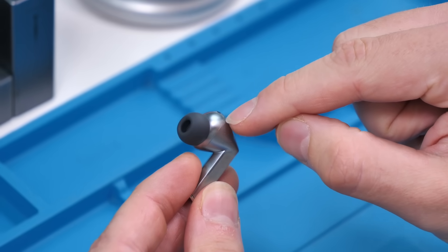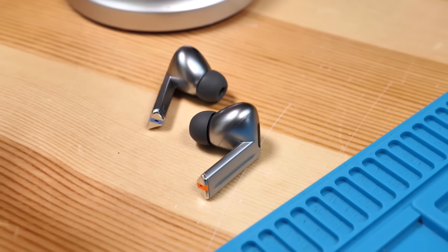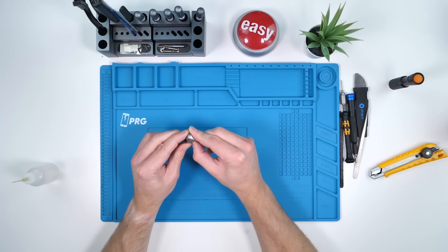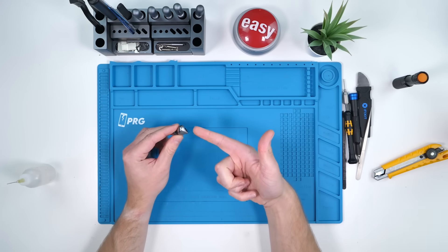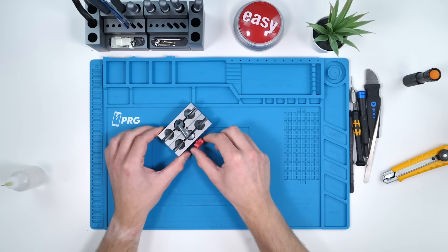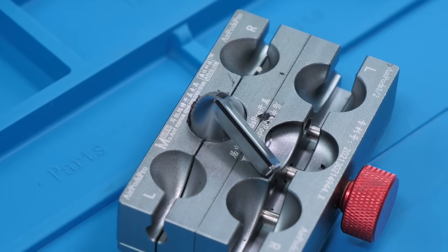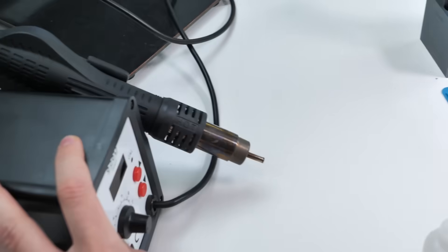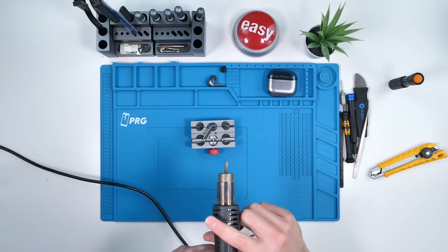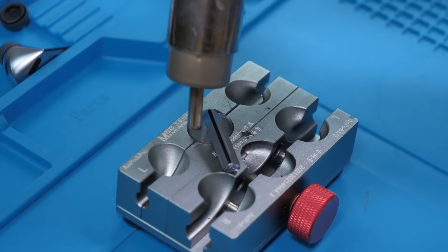We'll pull out the actual bud and check this out. Just like the AirPod Pro, these have a seam right over here, so they probably open pretty much the same exact way as the AirPod Pros. Unfortunately, the AirPod Pros are extremely difficult to do any repairs on, and I'm honestly not expecting anything different from these. We'll go ahead and grab our AirPod clamp — let's see if this fits. No way — it fits. It fits perfectly. So what we would do with AirPods is basically take our heat gun, turn it on, set it to Air Flow 3 at 100 degrees, and now the clamp pretty much does most of the work for us in this process.